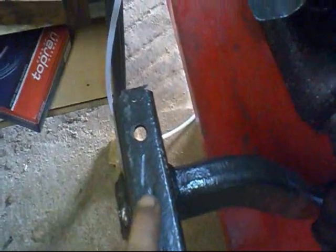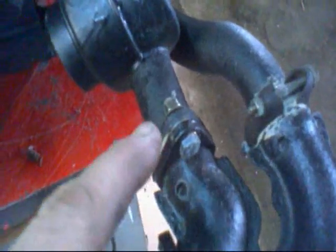We now have the front and rear sections of the heat exchangers attached. Leave this collar loose for the moment — same thing on the other side — because you're going to have to be able to wobble all this around a bit in the tinware. The engine bar is on; make sure the arrow goes towards the front of the vehicle. The exhaust is all clamped up now with exhaust paste and assembly paste. Leave this loose so we can wobble it about a bit — it's all in there, ready to be finally nipped up.